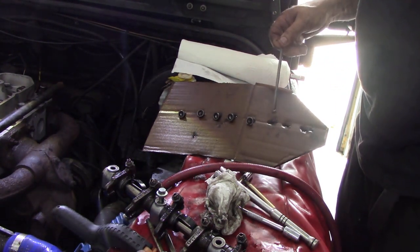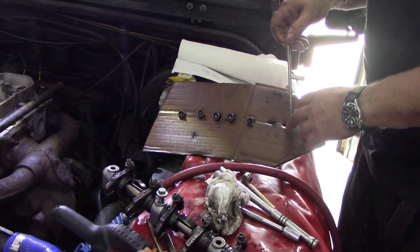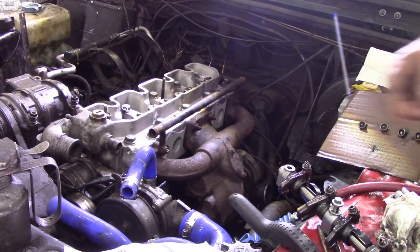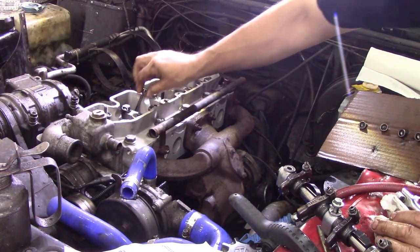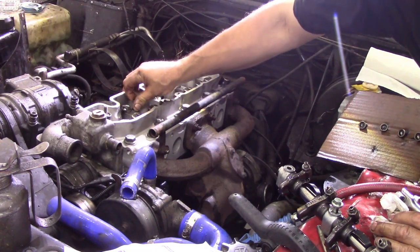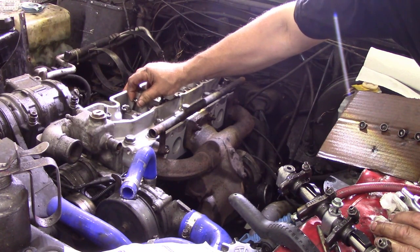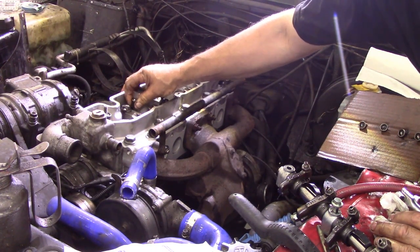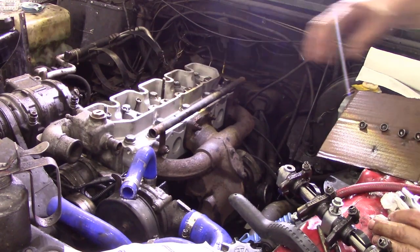What we're going to do now is start to push the pushrods back into the engine. I've put some oil down in the bores and I'm dropping them in, making sure they're located properly in the little sockets at the bottom. You can actually put them to one side and it's not quite right, but if you twist them and feel them, then they'll be okay.